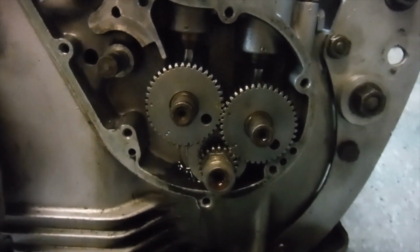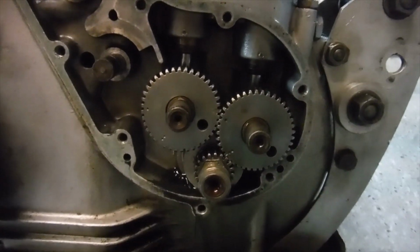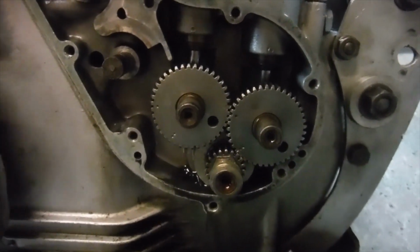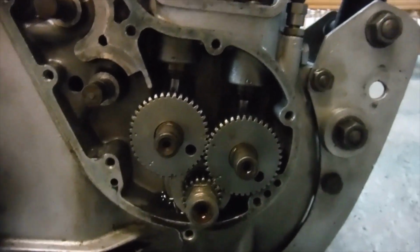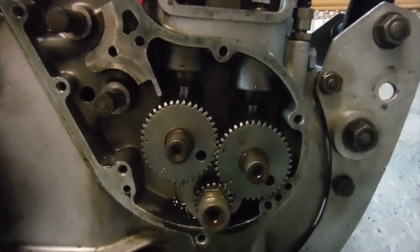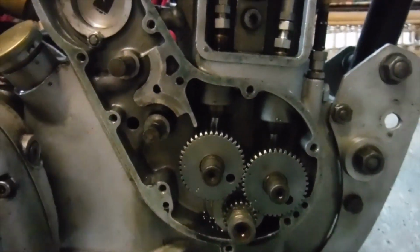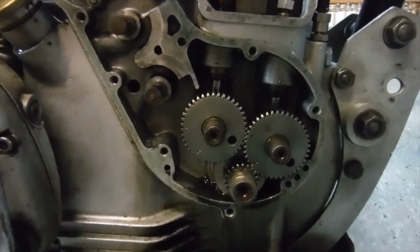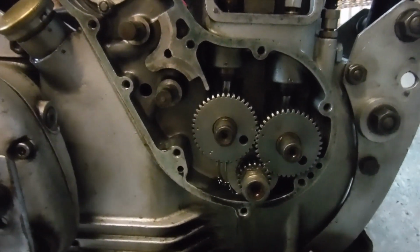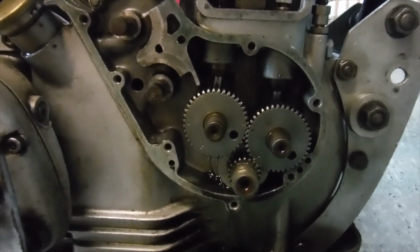So that's worth bearing in mind. It could be hard to follow this, but if you sit down and think about it, it makes sense, because 18 degrees of crankshaft rotation is quite a lot. So if you can get away with setting the cam timings in a danger area for each one, by one tooth or the 18 degrees, and the engine still turns over, you've got a perfectly adequate safety margin for running the engine when you time it on the marks or the settings that you want it to run on. So hopefully that will be of interest, rather than mislead or confuse people. I just thought I'd share that.